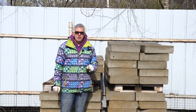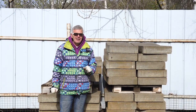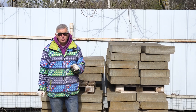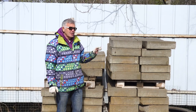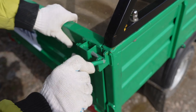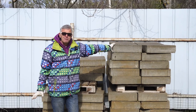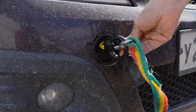Now we have come up with another test for our tricycle with Dunov's motor. You will see how a 3 kW motor pulls a large car weighing 1,400 kg. To make the test even more challenging, we've put 7 blocks in it — each block weighs 70 kg, so the total additional weight is 490 kg. Let's see how the motor with the combined winding Slavyanka will perform in this test.